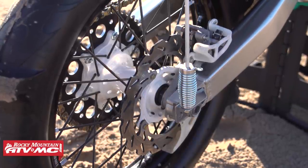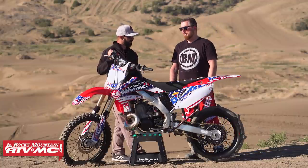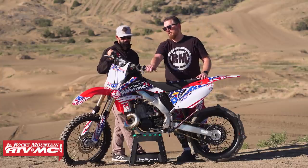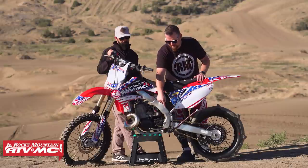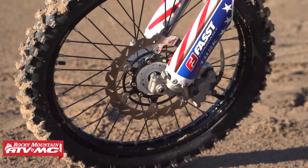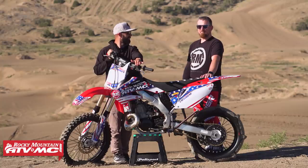We're not going to bore you guys with every single thing that is on here — we'll have all that in the description below. But what are some of the notable parts that made it feel more like a modern motorcycle — the must-haves for this bike? One of the first things you notice when you start up a 500 is how much it vibrates like crazy. So we got some Fasst Flex bars, and they help with the mitigation of the vibration. They also gave us impact foot pegs, which should help with the vibration as well. Braking was a little bit lacking on this older bike, so we put an oversized front brake rotor from Tusk on there — excellent stopping power. And the Magura hydraulic clutch: if you want to have better clutch pull, that thing is absolutely key. Mandatory on a 500.